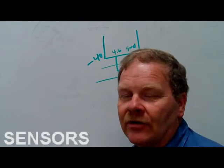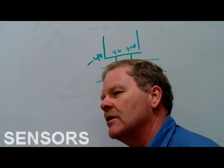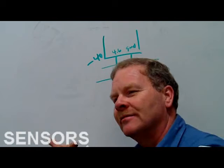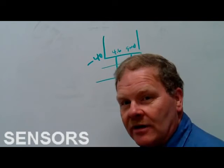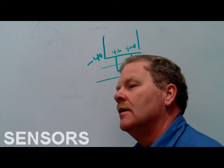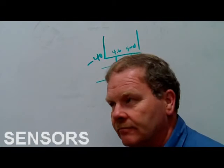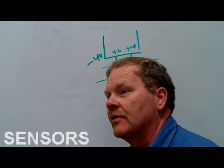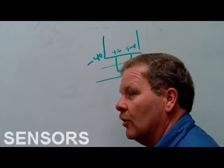Now let's see who can remember this. Tyler probably remembers it because he's pretty good at remembering stuff. If I was going to say something was 40 degrees below 0 Celsius, what would that be in Fahrenheit? Same thing, because that's where they cross, right? So minus 40 is what you'll see if you unplug that sensor. If you see minus 40 on your global OBD2 reading, you know it's unplugged, or the wire's cut, or the sensor's open. If the sensor goes bad, will it tell you it's minus 40? It will if it's open. If it's shorted, it'll tell you it's 256 degrees or something like that. So basically super hot is shorted, super cold is wide open.